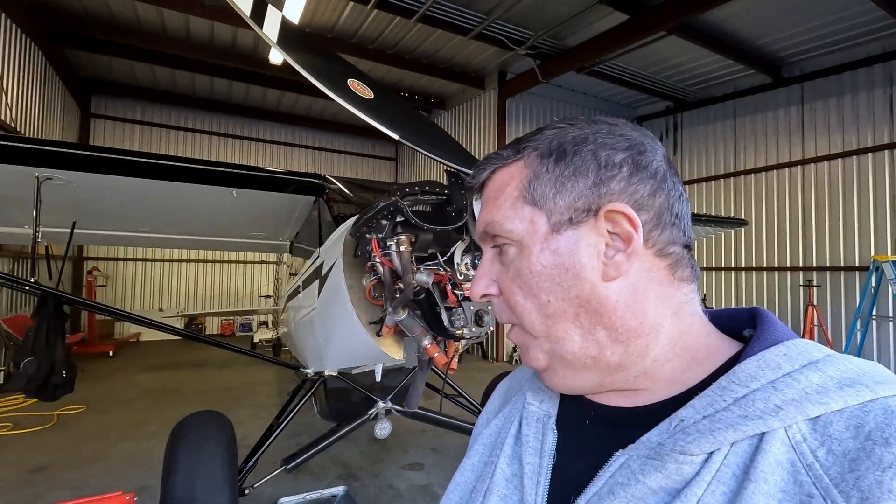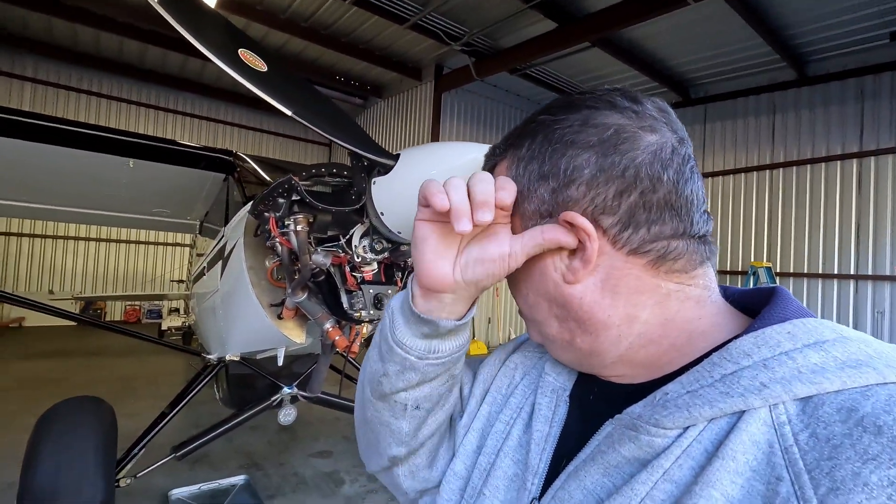The problem followed itself. Cub Crafters did not have coil packs — it would have been nice if they'd said, 'Go check with LightSpeed, they may have them,' especially with my BFR coming up and the plane grounded. Replacing the bad coil pack, the rough running on the right side went away and the RPM showed stable as well. So it's not a cabling issue, not a wiring issue, not a shielded wire issue — it's a coil pack issue. As Eric Massey had pointed out, when these coil packs go bad they can start doing all kinds of electrical nonsense in your airplane. If it's properly grounded it shouldn't — and I think that's part of the problem.